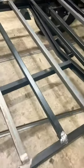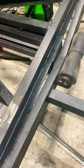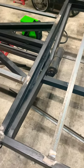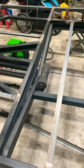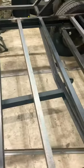On this piece right here — I added this because all the tongue weight, now that the trailer is going to be a lot heavier, this cross beam was deflecting more than I wanted and wasn't putting a lot of the weight into the trailer. So I connected it to the mid beam to help stabilize it. I'll probably add another one on the other side.